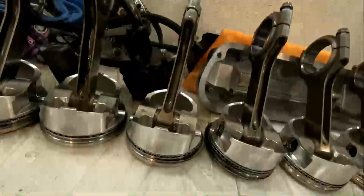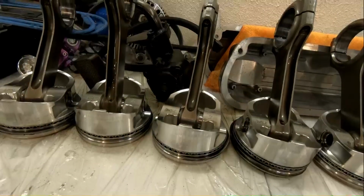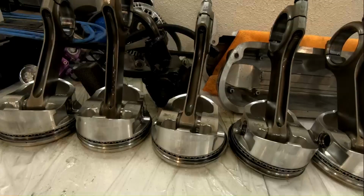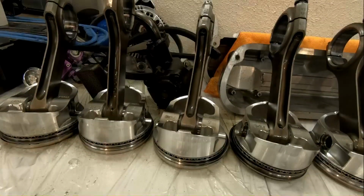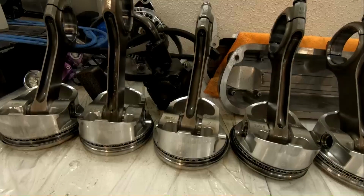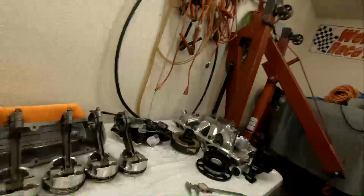I do want to check the rings and see if I can find something there. Because like I said, we still had that pressurizing the oil system. So we're still kind of searching that, but I think that these head gaskets are going to be the issue. I really do. But anyway, so that's kind of where we're at there.